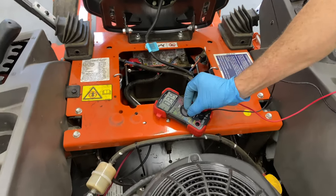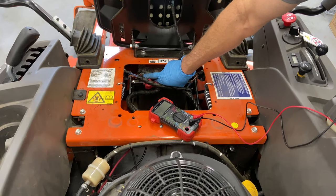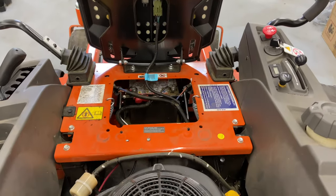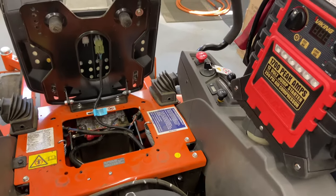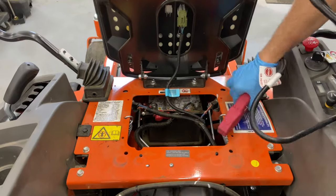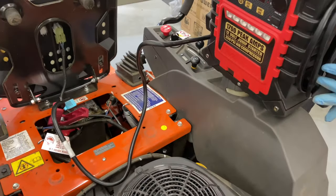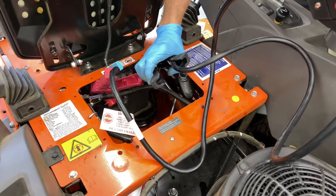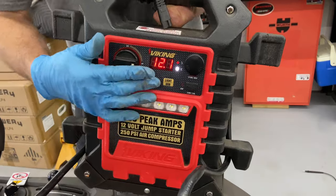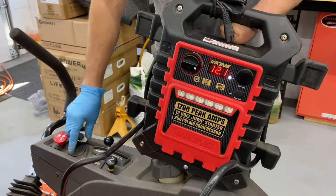So I'm going to carefully put my jumper pack in here. These terminals are real close — you don't want to arc. You don't want your wrench to hit the positive and any part of the metal frame because you'll arc it, and it's almost like welding. My jumper pack does not turn on until I turn it on, which is nice. We'll put the positive on, then connect the negative. It was showing 9.9, but when I turn mine on, now it's showing 12.1. This is about amperage — it's not really about voltage; it's about how much amps you have.